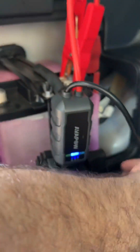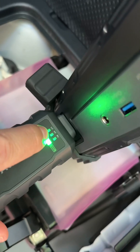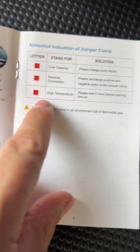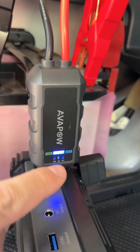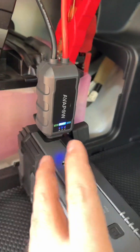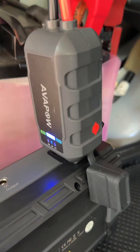Something I really like about this connection is that it's a smart interface. You can see it has indicators: LC means low capacity — the battery is discharged; RC means reverse connection if you connect it in reverse polarity; and HT means the interface could be overheated. You can see the contactor closing and opening — when it closes there it is, then it opens again and goes to standby because there's too much current flow. It also gives you a force start option: if the above operations cannot start your car, press the force start button and start the vehicle within 30 seconds.